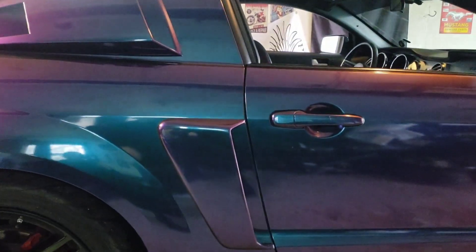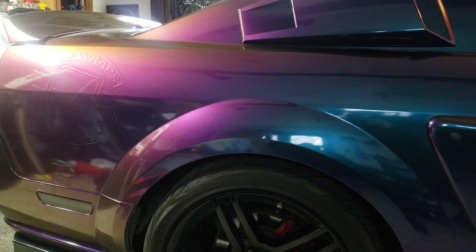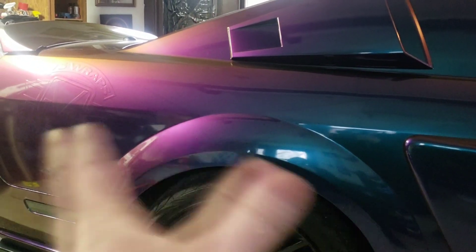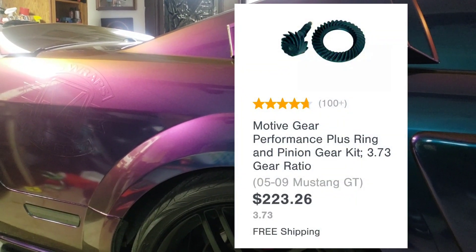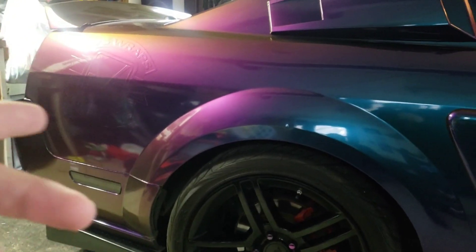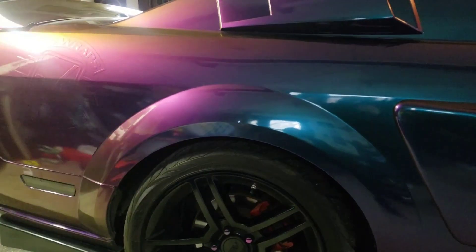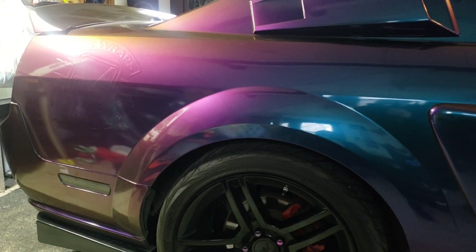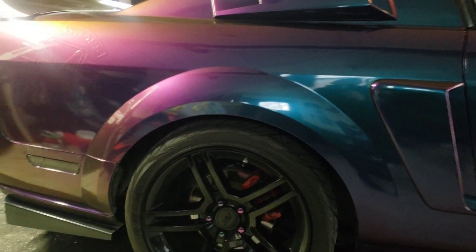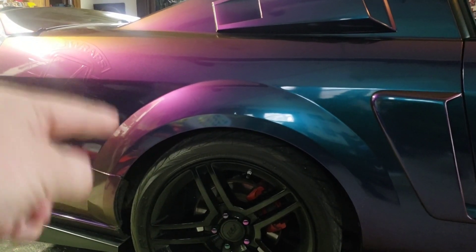4.10s, I'm going to tell you, it's not going to be very highway friendly. It'll be up in the high RPMs. 3.73s, those are probably going to be your best bet. You're going to love them. I'll throw some photos up here to show you guys — I would maybe recommend Motive. Keep in mind, there might be brands or gears that are even better or products one level higher, costing you over $300. If you want to shoot for that, you can. That's not a big deal. I'm going to try and do this the best I can for under $300.